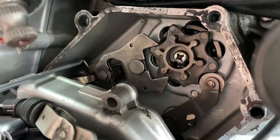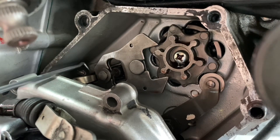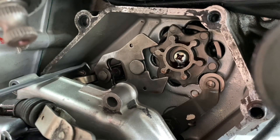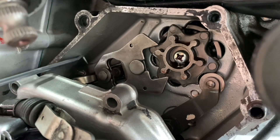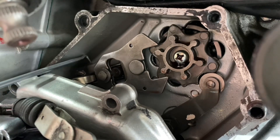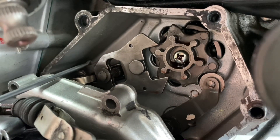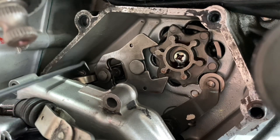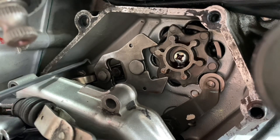Let me get this hooked back here and pull. I don't know if this amount of play is normal — this is all that there is. This is all the shaft play in and out, left and right. I'm hoping that this is normal and that the nut on the other side inside the engine case isn't loose.